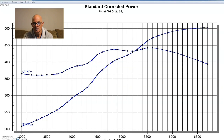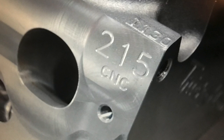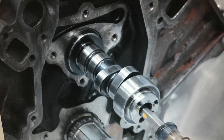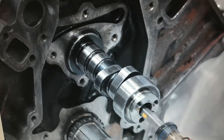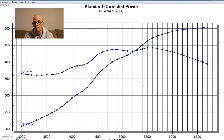Stepping up from the 4.8 liter, we're going to the 5.3 liter — this was actually the Big Bang 5 liter, done for Truckin' Magazine. We built a 5.3 with a stock bottom end, extra ring gap, and TFS215 heads. It also had a healthy Comp cam: 617/624 lift, 231/239 duration, and a 113 LSA. It had an LSXRT intake manifold and a FAST manifold. So heads, cam, and intake on a stock bottom end.